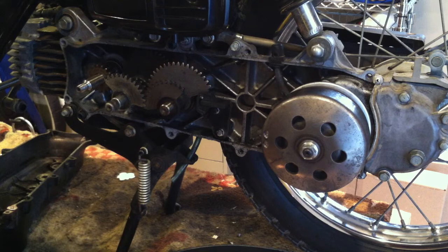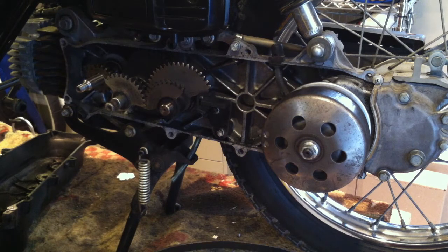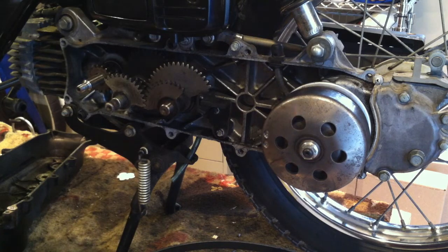I'm putting the cover back on the variator — I'm sure there's a more appropriate name for it, and I'm sure somebody will let me know. I went with 36 grams — remember that. I was trying to tighten it with an 8mm socket and it's only a 7mm. That's much better.